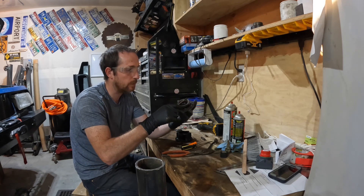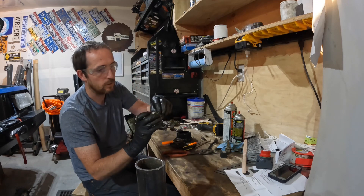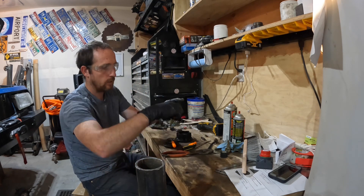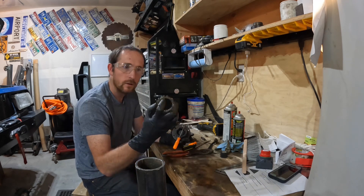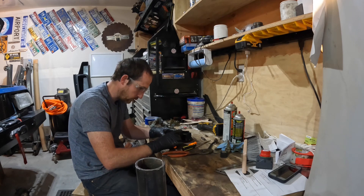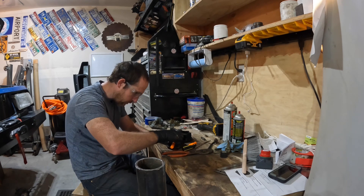Take the straight pick and run it around all the way around so you get a full revolution sticking up above it. Then take the gear — there's a section here that doesn't have teeth, and the rest has teeth all the way around. Start at the point that doesn't have teeth and basically screw this onto that spring. Also note: there are two little ears here that have to match up with two little ears on the other piece, and a little catch that drops in between two of the ears.